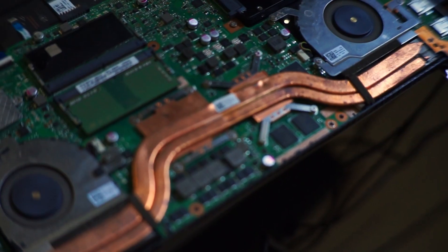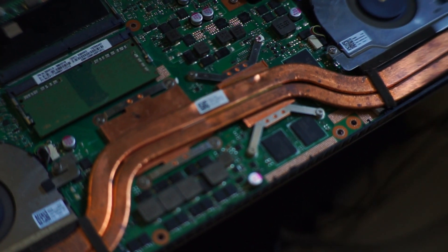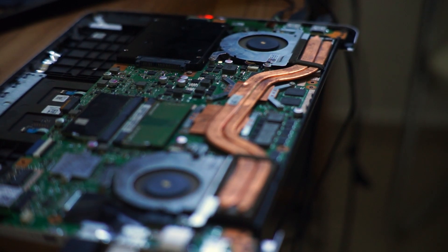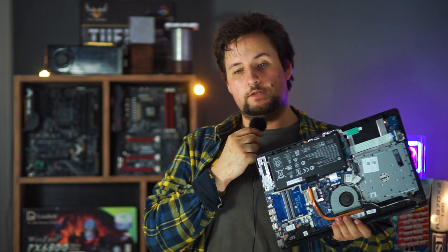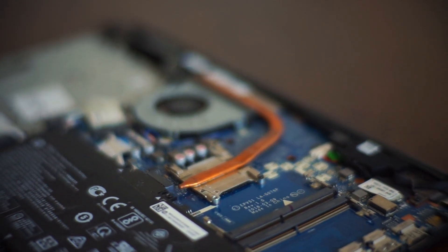Laptop cooling solutions are pretty anemic, as you can see by this example here. Although this is kind of a better example because it has two fans and two heat pipes, it also has to cool a dedicated GPU, so that makes it pretty bad at handling high workloads. This is why undervolting on laptops such as this one with an Intel chip, or this one with an AMD chip, makes a lot of sense. This unit here has an even worse cooling solution with only one tiny heat pipe and one fan to cool a Ryzen CPU — and it's only a 15W CPU, whereas the other was a 35W CPU, yet it still throttles and overheats all the time.